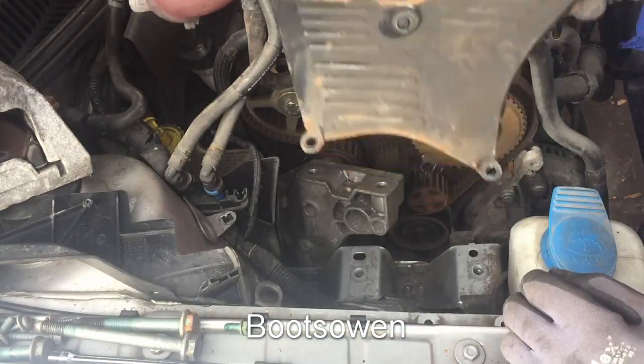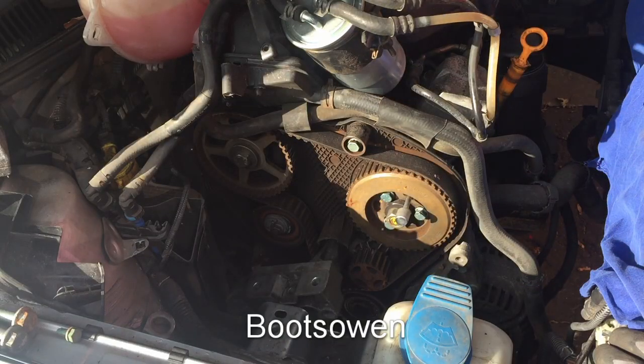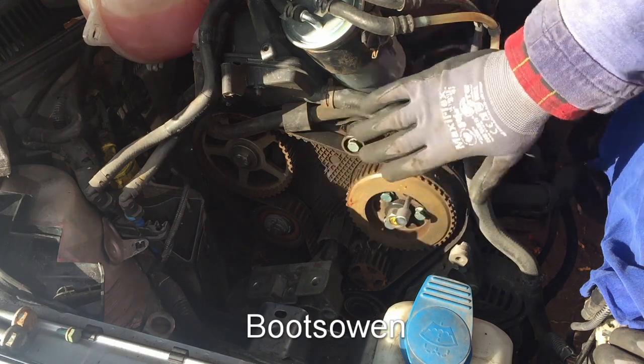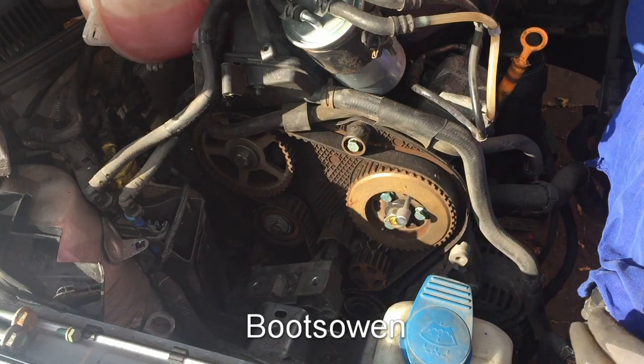So that's the cover, comes out. We've got this pin in, we've got the lock on the end of the camshaft on the far side and we've checked that the crankshaft on the end of the flywheel — that the timing marks are aligned. They are, so we'll go to loosen this. We're about to take off the timing belt.